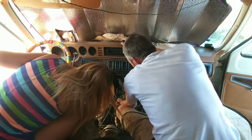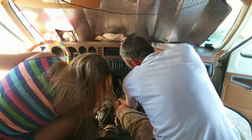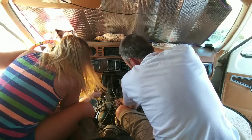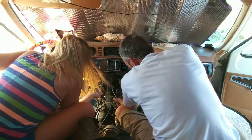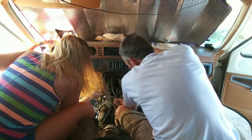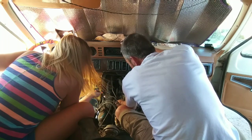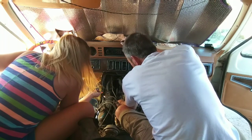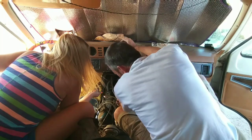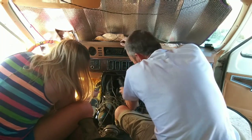They're using the fast idle cam for your idle screw, and this is actually the idle screw right here. And somebody lost this type of screw and put a different screw in there, but at least it's in there. And they even put a lock nut on it. It's supposed to have a spring on it like this. And this thing, see how the spring is compressed all the way down? No, it's supposed to be out a ways, and then this guy's supposed to be in a ways, so it contacts there.